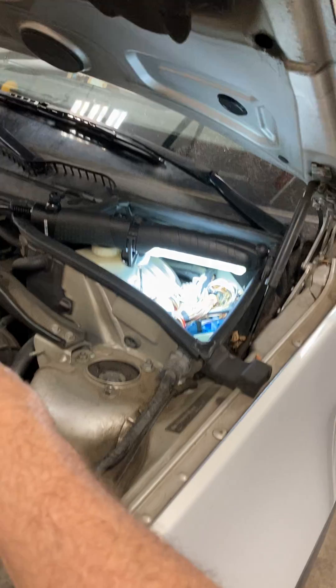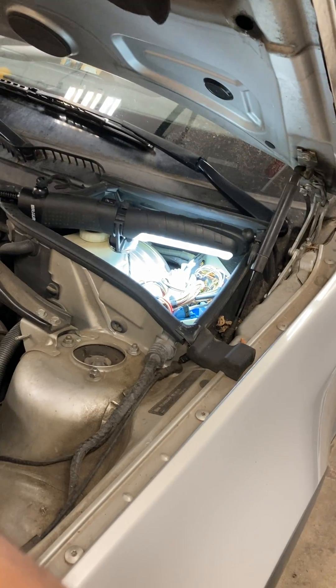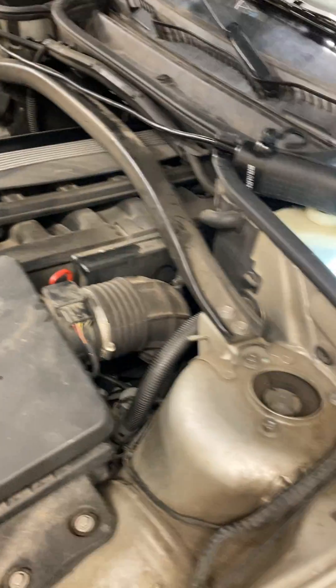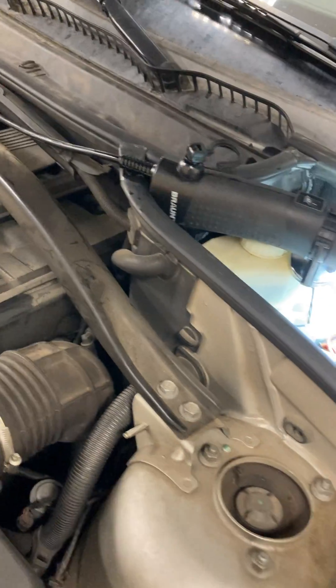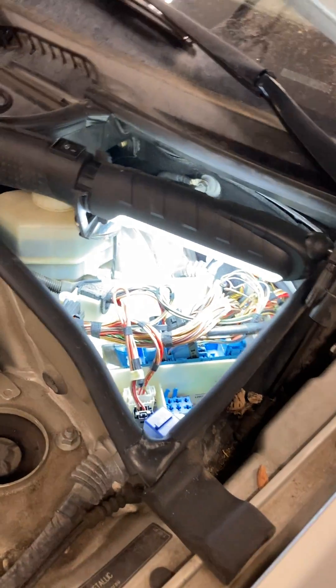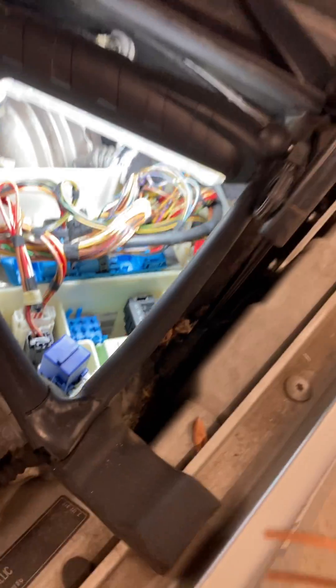I'm working my way through the diagnosis. I need to test the starter — see if electricity is getting to the starter, telling it to start. It's buried under the intake manifold, and good luck finding that going willy-nilly. But if you take the starter relay out of the fuse box, you can jump a couple of those leads — 30 and 87 for your information.